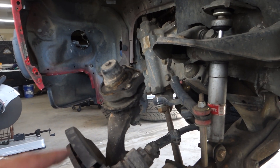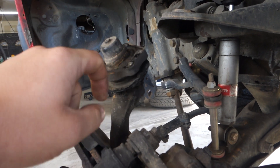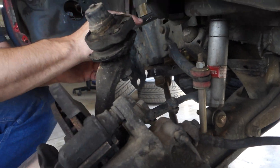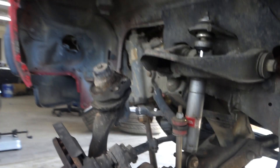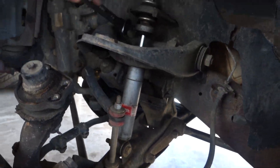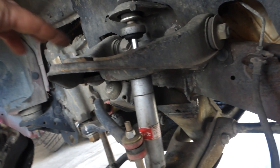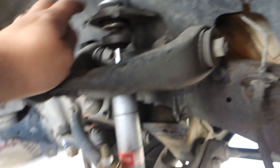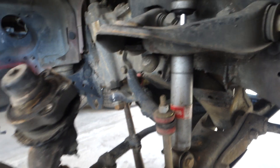His boy's getting the bolts out. Make sure this doesn't fall and hit you — it's held up by the control arm. Those are the same size, either 21 or 22. So you take these four off, these two off, then take your shock out, slip the new one in, bolt it all back together — done deal.